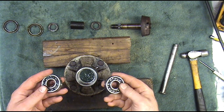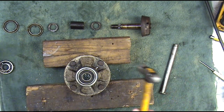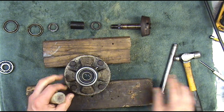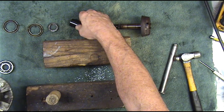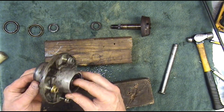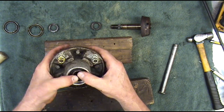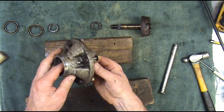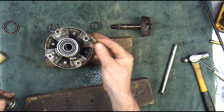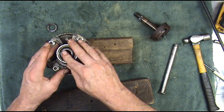We've got our new bearings here with the seals knocked out of them. We're going to go ahead and put them in. It's not ideal to beat on new bearings, so I've got this little piece of plastic — it's okay just to tap them in gently like that. Then the spacer goes in the middle. These bearings almost fall in; they're not that tight in there, you can almost push them in with your finger, so just tap lightly. This spindle has seals on both sides, and these little spacers sit right down in there.